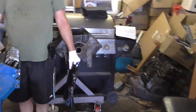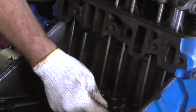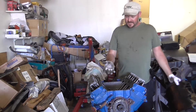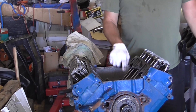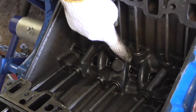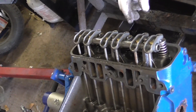Here's the intake port. It has its own push rod, its own lifter, its own camshaft lobe. The camshaft lobe lifts up, pushes up on the lifter, pushes the rocker arm, actuates it, compresses the valve spring, opens the valve, and you get your intake charge into your engine. Looking at the long block assembly, you've got your intakes, push rods, lifters, and camshaft. The crankshaft is underneath — you can't see it — but you can see a lobe of the camshaft through that little hole, and that lobe pushes up on the lifter.